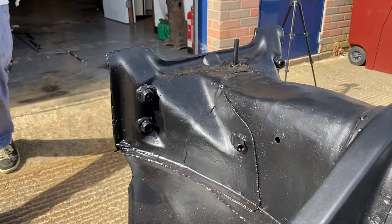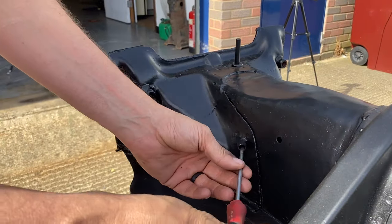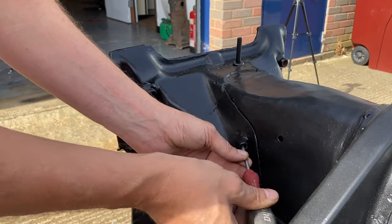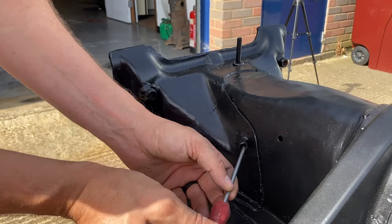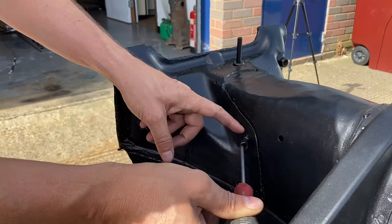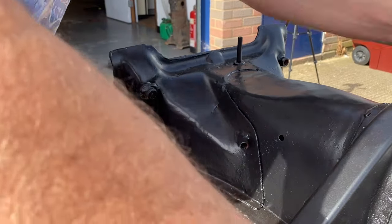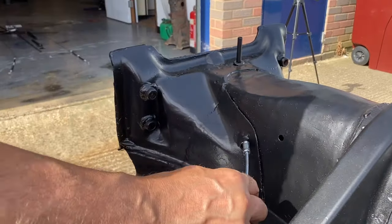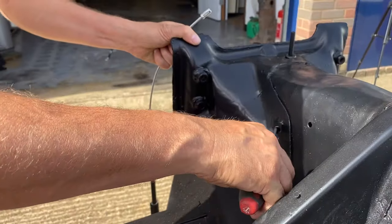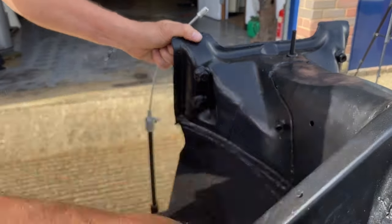I mean, it's quite a good example of just because something's been rodded through, you know, we've had things in and out there to check, but it doesn't mean that it's big enough to actually take that whole width. That seems pretty clear. But you know, a bit of warp in here. Yeah. From that weld, and all of a sudden you've got no chance. I think that's what it is, at the angle of it. I think you're right. I think it's a bit of penetration from the weld right where it starts to get small. Do you know what I mean? In the tube. Yeah.